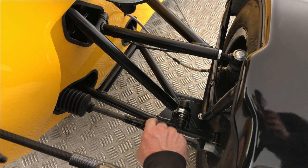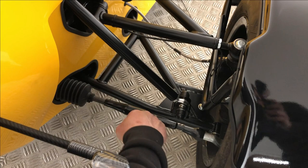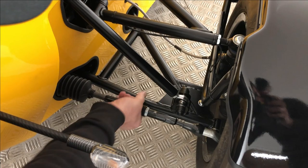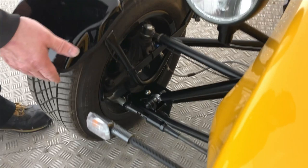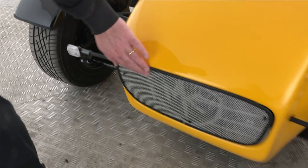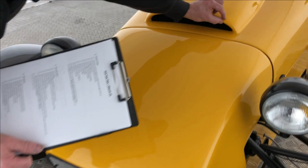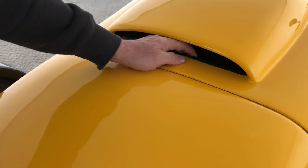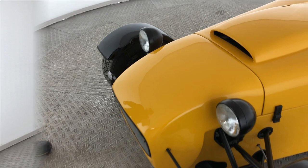These are covers for the steering rack — this knuckle here, if that wasn't covered, it would be a foul at 2.5mm. That's why these covers go over them. All the front end — mud guards, wishbones, ball joints — if I can't get my fist in there, it doesn't need a cover. These indicator extensions and your front grille mesh: we've put mesh over ours because the grille underneath would have a sharp edge. Even if you've got a bonnet scoop, make sure the panel is a flush fit — if it has an edge you can touch with your fist at that radius, you need to sort it.